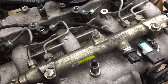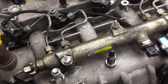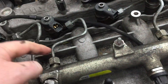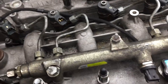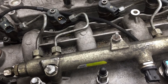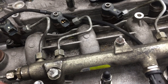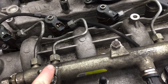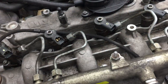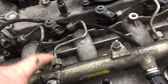If you're trying to diagnose it: you crank the engine, and mechanically it's building pressure and pumping. The injection pump should be able to build pressure and force fuel up. So I should be able to crack one of these lines off with a wrench and see a little bit of fuel drip out — it shouldn't be a ton, there's not a whole lot that comes through at idle. These are high-pressure rails, so the pressure is really important. You can just barely have these cracked and the engine won't start — just barely tighten it down and all of a sudden it holds pressure and starts. These are super sensitive to being tight and having no leaks, because if there's any leak you'll lose all your pressure and it won't inject, won't burn, won't start.